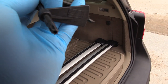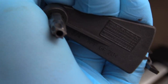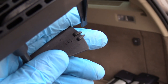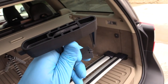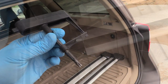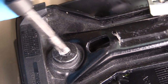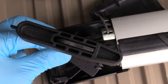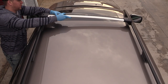You need the special screwdriver to install or remove them from your car. What's special is it has a hole in the middle — you can see it clearly. Also, the screwdriver is designed to tighten bolts to exactly 6 Nm: it will bend, and once you reach the arrow you know it's enough — you don't want to over-tighten. These are the security anti-theft bolts, and you can now see the 6 Nm torque indicator clearly.